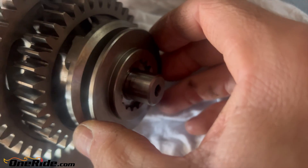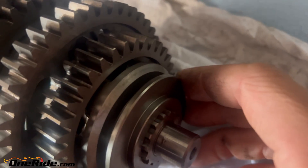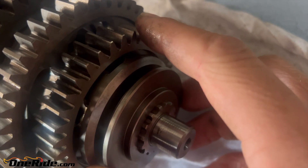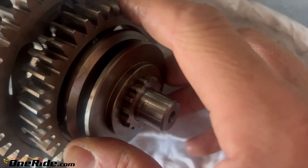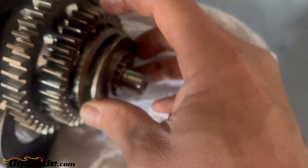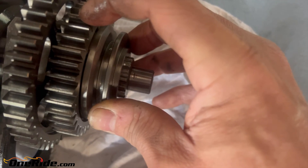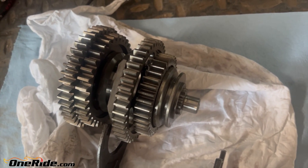You can see this is going to move into the gear and bottom out — it's not engaged. The rock would move this gear and it would fall into place and engage the gear, just like that. You can see it's sticking out, you rock it, and it falls in — that is exactly what causes the Can-Am rock.